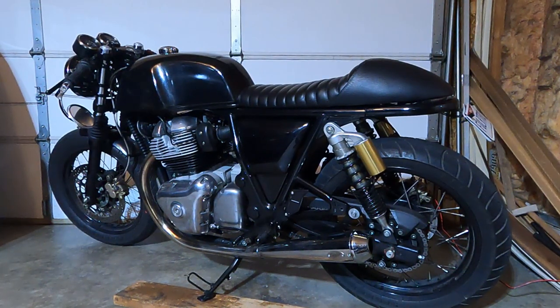So I went ahead and received the plug for the O2 sensor blanking, and I cleared the error, and it never came back. I was like, well, that's cool. And then when I put the Power Commander 5 in, the exact same thing happened. I got that error one time, and it never happened again. I had to clear it again. I don't know if that is a Power Commander thing or what, but you might want to invest in one of those error clearing items.